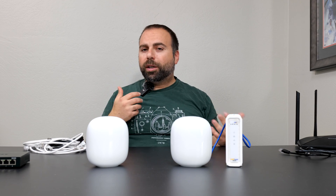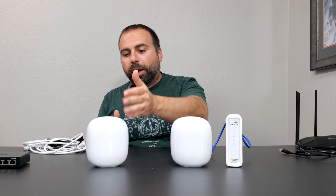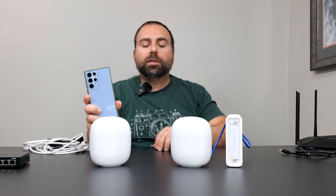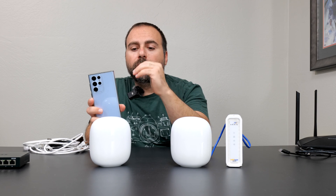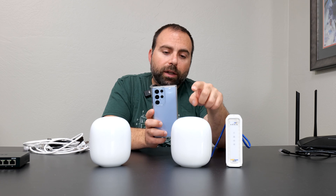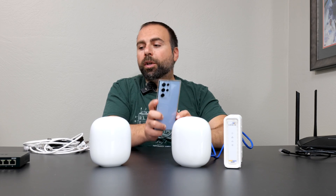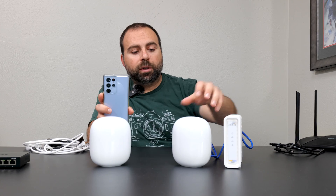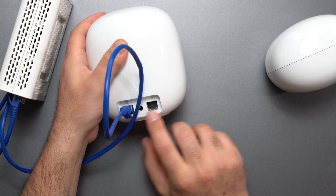What's the difference between wireless and wired backhaul? Wired backhaul typically gives better speeds. With wireless backhaul, there will be a drop in performance on the secondary unit because it's wirelessly communicating with the primary. Your device will automatically switch between units as you walk through your home and your Wi-Fi bars will stay high, but a speed test near the secondary will be slower than near the primary. With wired backhaul, you'd get full speeds at either unit. Note: if your internet speeds exceed gigabit, don't get the Nest Wi-Fi Pro — these are gigabit ports and you'll be capped.